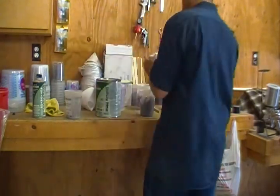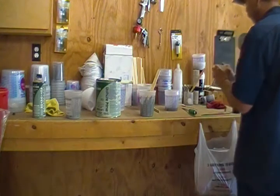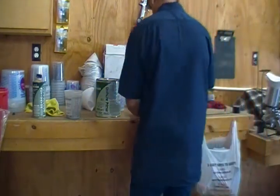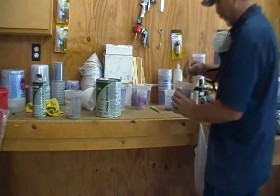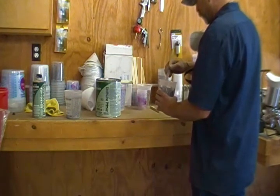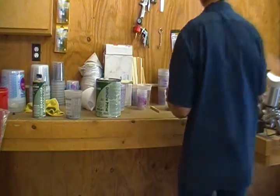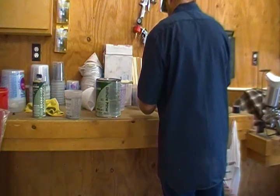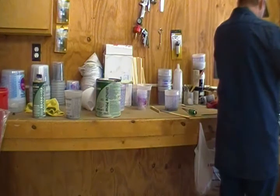onto the car to where we were working, and then we're going to turn our attention to where we were at and do a double coat on places we know needed more blocking. We'll apply a guide coat, and then we will walk away from this until tomorrow, where we will begin blocking this out and see what we have left. We should only have one spot left right there that we're going to have to build up one more time. The rest of it should be finished, and we'll be moving on shortly over to the paint booth.